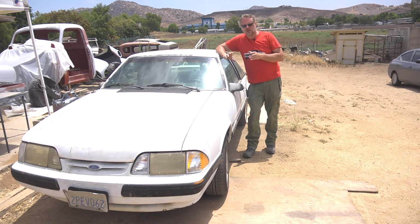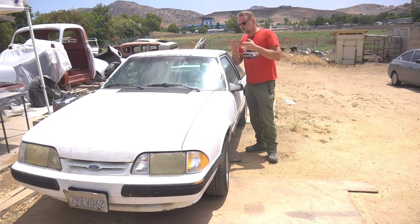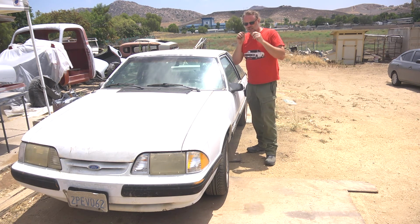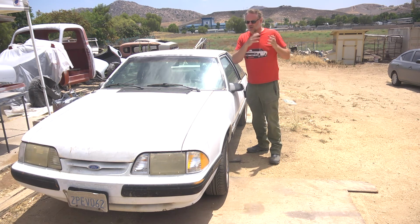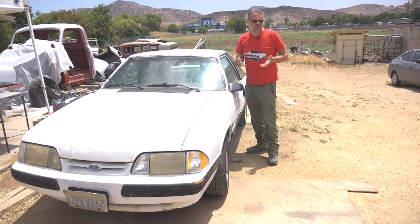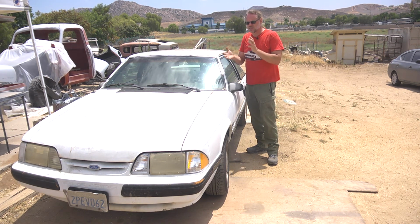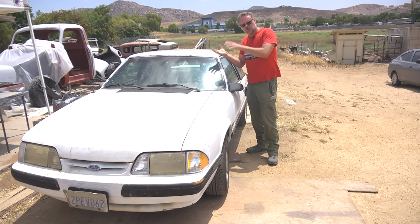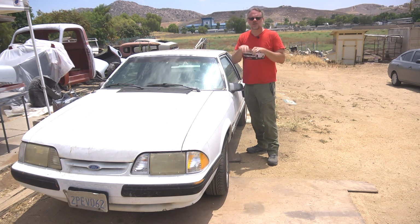I find it remarkable how this is clearly that in-between step, where a tune-up meant plug wires, cap and rotor, oil change, checking timing, checking your timing throw, playing with a lot of little fiddly things. If you go back even further, cleaning or replacing the points and adjusting them. Let's get everything dialed in just right. And in our current cars, where everything's locked down, there's not even a distributor to play with the timing on. It's all completely controlled by the computer. So this is a weird, ambiguous in-between step between much older setups that we commonly see here at the Pit Stop Ranch and the completely modern cars, where all the tuning is done with the laptop.